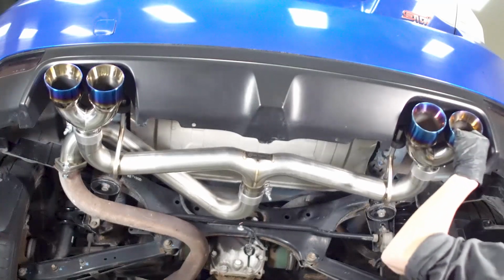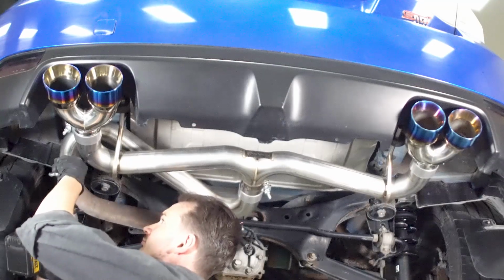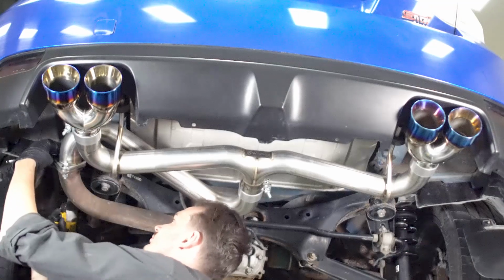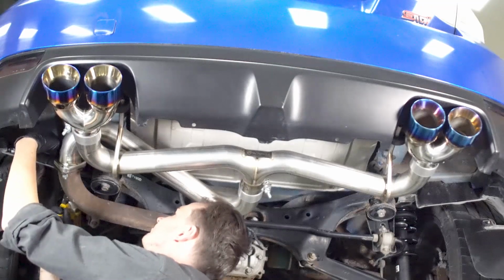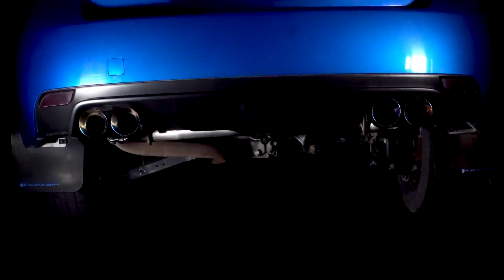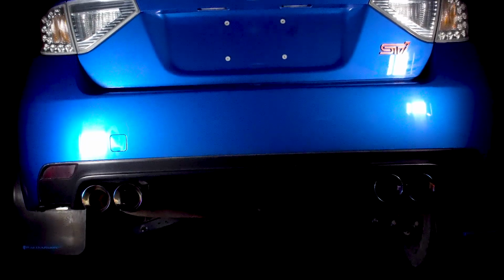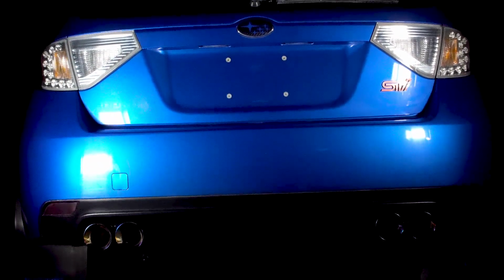After your final adjustments have been made to the exhaust tips, have a friend hold it in the desired fitment location, then tighten the flange bolts with a 15 millimeter to 30 foot-pounds. Go ahead and drop the vehicle back to the ground and drive it and make sure there is still no contact with the bumper. We also recommend retorquing the hardware after 2 heat cycles.